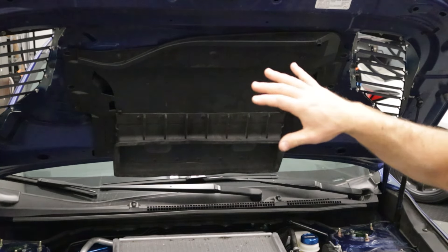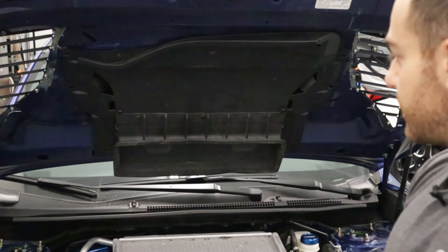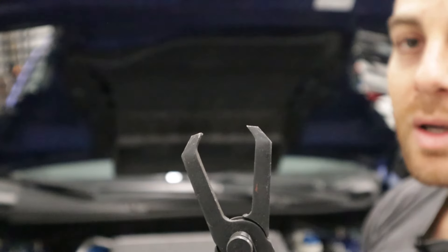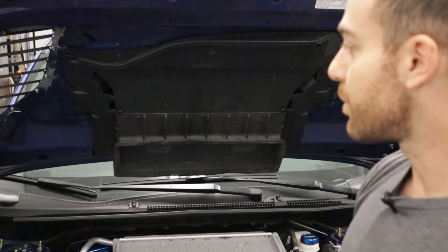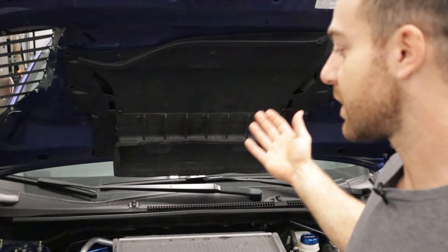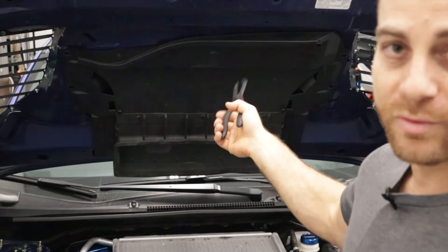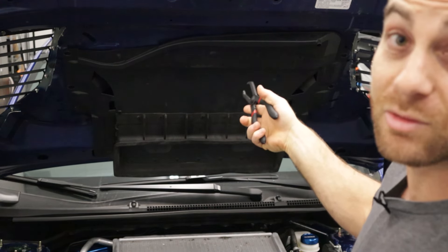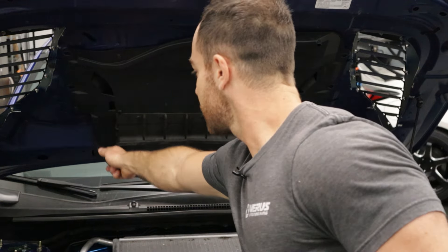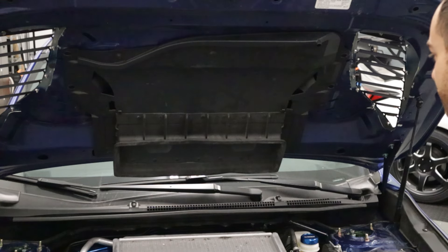At this point you'll have this picture as soon as you open up the hood. We're going to use an 8 millimeter socket on a quarter inch drive ratchet and a panel popping tool. I literally broke about 95% of these plastic push pins — and this is a brand new car, like 3,000 to 4,000 miles on it. If you guys can remove this without breaking them, comment, because I want to know how you did it. There are about 10 push pins total — one, two, three, four right there, two in here, and a few more.